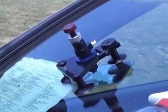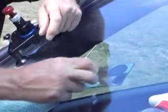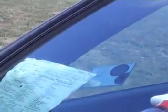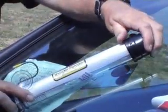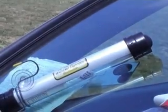And now it's time to cure the break. Release our suction cups. Place our mylar square right over the break, and give it a 3-minute cure. You have a nice perfect repair. Then we have one more over here that we're going to do. It's another angel wing break.